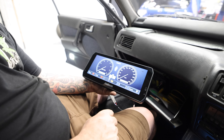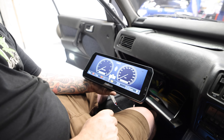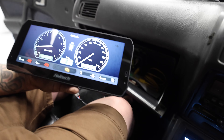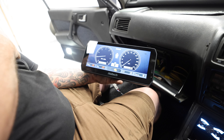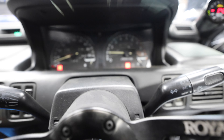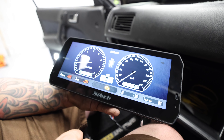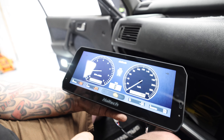We could start it and see how it functions. Once you start it, you can see the check engine light is on — and it's also showing on the dash. That's because I had to unplug the wideband in order to do this, so we're running the car with no wideband right now — which is why it's stumbling.